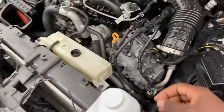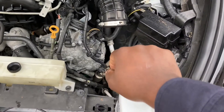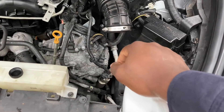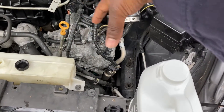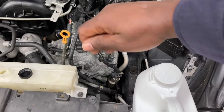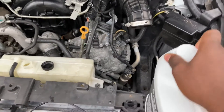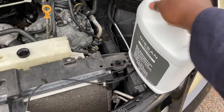This fourth port is at the topmost, highest-point corner of the radiator, and there's a bleeder screw right here. Usually people know about this one because when that gasket fails it starts spraying coolant backwards — your timing cover can get splashed in white, or sometimes your air filter box as well. You can either replace the gasket or just tighten it a quarter turn. It's pretty simple.